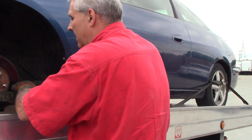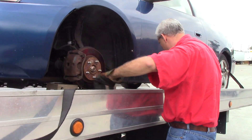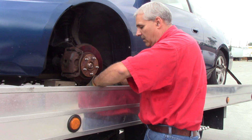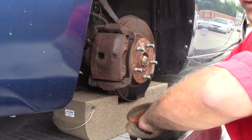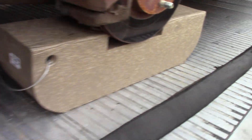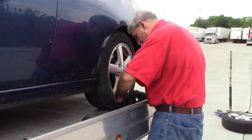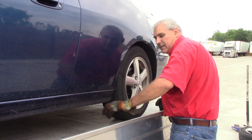We're going to start — we're going to take this one off. I like to tilt the bed before I take anything off, so there's some pressure on the front chain that holds it on the bed, but I'm not all the way off. Just like always, I'm putting everything back because I'm ready for the next tow. I like taking the two back ones off before I get it down on the ground. I put this back religiously every time because I'm getting ready for my next tow.